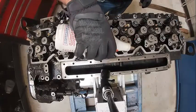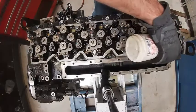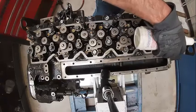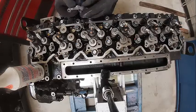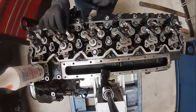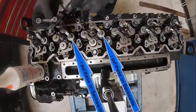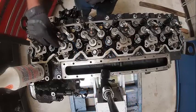If you don't keep them in place, it's going to change your overhead set sooner than it would if you put it back the way it went. These are what we call a floating valve bridge. This side kind of moves a little bit — this has something to do with the exhaust brake when we get that on. Notice one side's slotted, the other's not. That's to help it slide as it actuates.